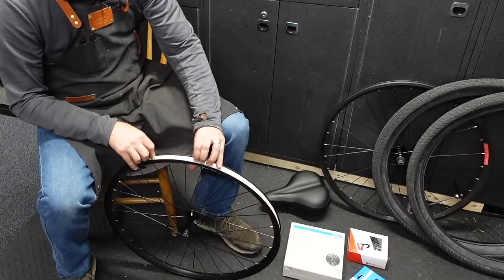Here's the high limit screw. We're gonna back that off. And that chain is gonna drop right into its happy little, littlest cog home. Our cable tension is still low. So we're gonna grab it and undo it just a smidge and then redo it. Okay, cable tension's too high, so we're gonna turn in the barrel adjuster a little.